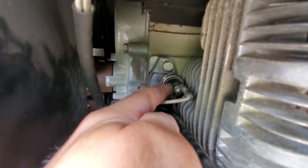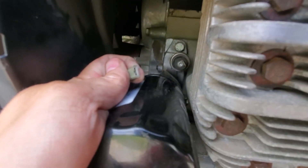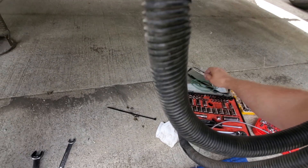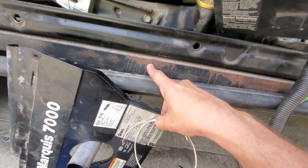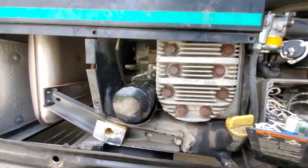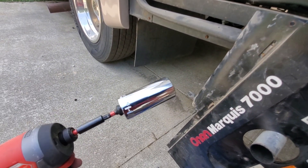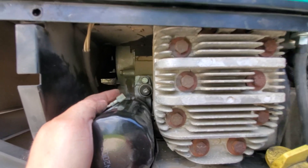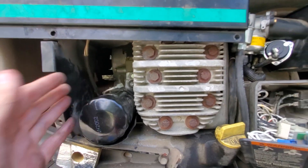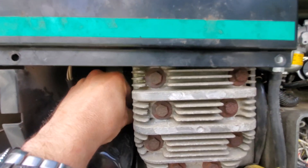It's this white wire going to the switch. A simple thing to do to test if it's working is just pop this wire off and get a jumper wire. I'm using a simple cable — plug it into that clip and hold the other end to the chassis here to ground it out. That effectively bypasses the switch, and if everything runs while it's bypassed, you know your switch is bad. To replace it, I'm using an inch and sixteenth deep well socket to back that out. It was super simple — not hard to get out at all. When I pulled it out, I had minimal oil leakage, maybe a couple drops down the front. I've already put it back in because it seemed to be working on mine, although I'll probably go ahead and replace it since I've got everything apart.